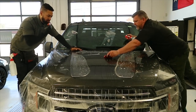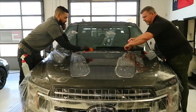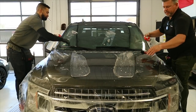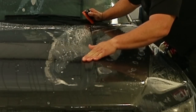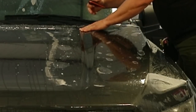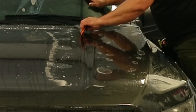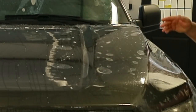We've got the film up here now. This is going to be the hardest part of the install — getting this down. So we're going to flush it with plenty of tack. Now you can see it's running all the way down into there. I'm going to take my hand and give it a swipe, get it all up here and hold it for a second. Where I have the edge prep I keep my fingers right in that corner — now it's locked down. You can push it down this way or pull it up that way; just make sure you get all your moisture out.